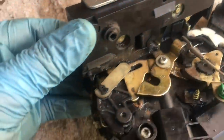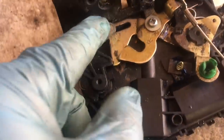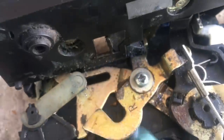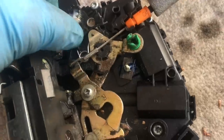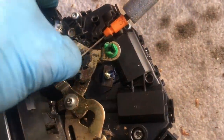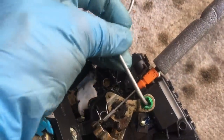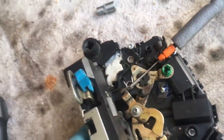On the control arms, note the positions when you reassemble - it's very easy to get this plastic piece on the wrong side of the metal piece. That piece goes down there, that piece goes into a little hole in there. This arm controls the locking, and this bit goes off to the door locking - the little arm goes to the top of the door. Put that back in later when we assemble it on the car.